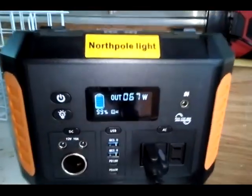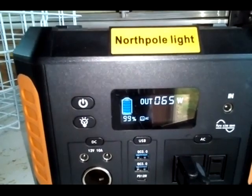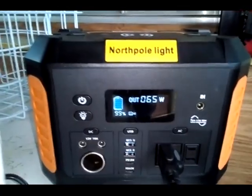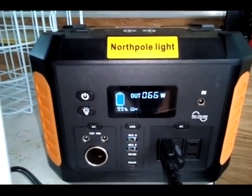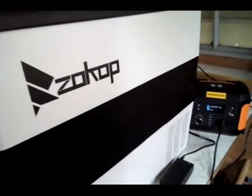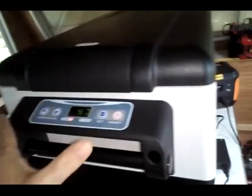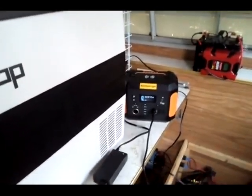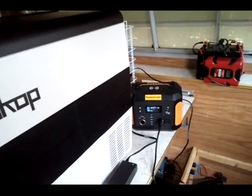The wattage is going up into the 60s — much higher than the chest freezer in the house. I saw 70 watts, then 71 watts. Given the fact this has to go through a cool-down cycle, it draws a whole bunch of power just to cool down. When you buy something like this or a power station to run it, figure your cool-down cycle in — you're looking at something running 70 to 80 watts for at least three to six hours pretty much non-stop.